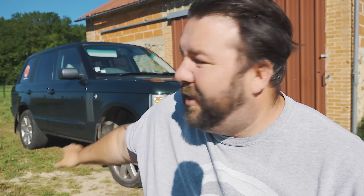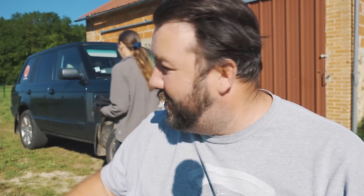Range Rover — I don't know if you can see over my shoulder what the problem is. The front suspension is in the air, the back suspension not so much. All the lights have gone out for the air suspension; it comes up 'air suspension inactive.' I was trying to lower the suspension and the front left-hand corner wasn't doing anything, so that pointed us to the front left-hand corner.